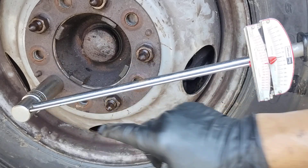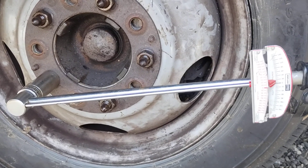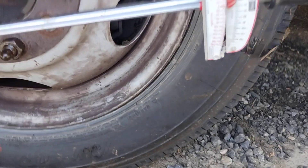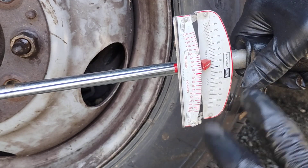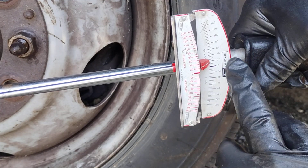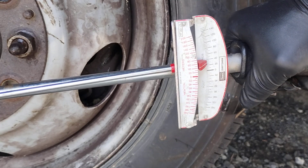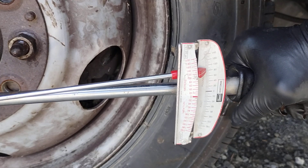Alright, so let's use that bolt there. I have this — let's see if it's wedged — so I'm going to let that turn a little more. What I did was I let it turn and wedge that. Now keep an eye on this beam bar. I can lower it down for you a little more and turn it. You're going to watch this increase. At some point around 80, it will stop increasing, but I'll still be able to rotate the bar — rotating the bar but not increasing torque foot-pounds. It just means I'm stretching or putting tension on the bolt nut only, but not getting any extra clamp force.